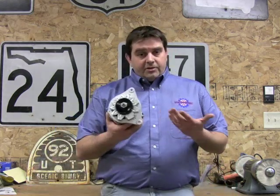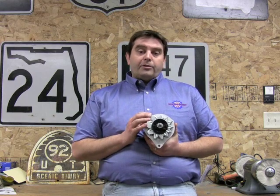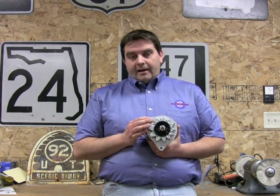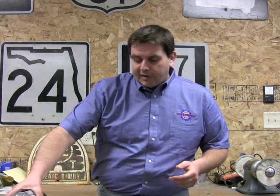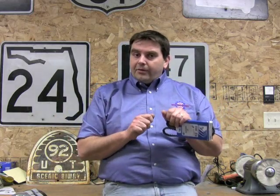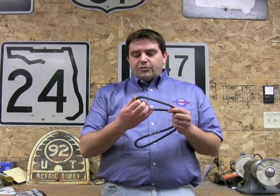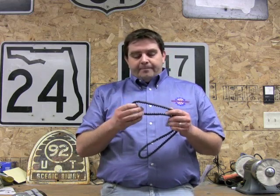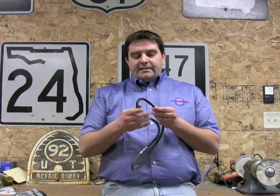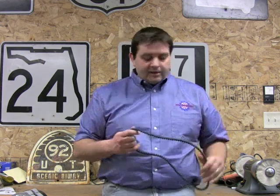So let's go ahead and change our alternator out. First thing you're going to need obviously is your new alternator. This is our high performance version and it puts out 43 amps, which is more than enough regardless of what you're running on your car. Since we're here, we may as well change the belt. Take a look at your belt and bend it a little bit — if you start seeing some cracking, it's probably a good idea to replace it. You'll notice on the old belt the ridges are on the outside, and on the new belt the ridges are on the inside. These belts are actually tapered and the smaller end goes on the inside — that's how you can tell which way is which.